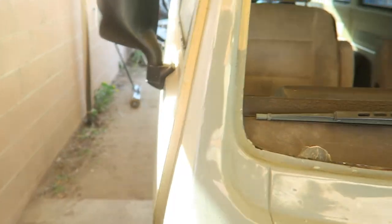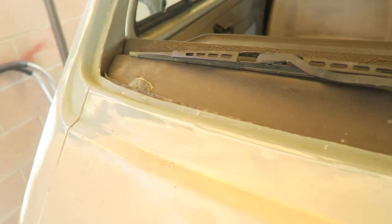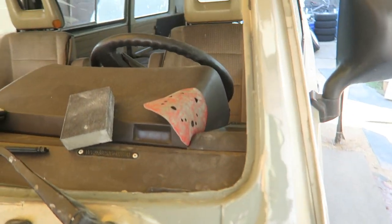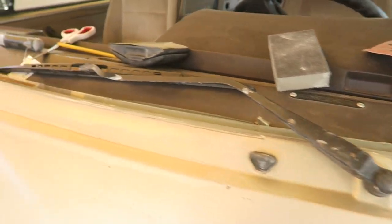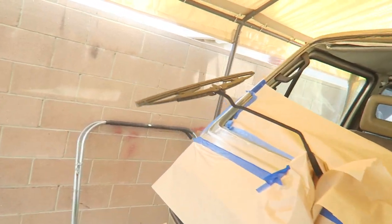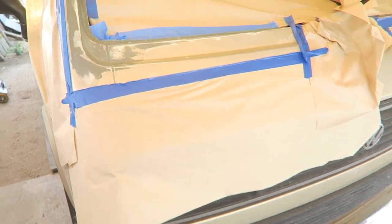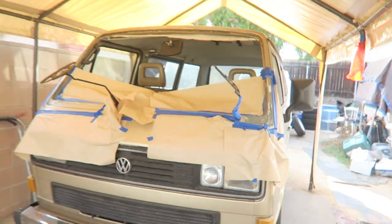The primer's on it right now. I'm gonna let it dry throughout the night and then tomorrow we'll spray with that champagne color. The primer dried overnight and here it is now — I just hit it with some 220 and it is ready for paint. Look at that — that looks good. I just got it hit with paint, now I've got to mask it all off again. All masked off and ready for some paint. Hopefully this color matches — it looks close. Champagne Mist, hope you don't do me dirty. I also tried to fold the tape over on a lot of edges to give it a softer edge so the transition's not as rough.